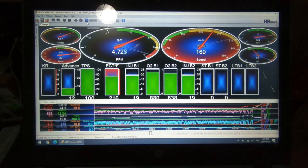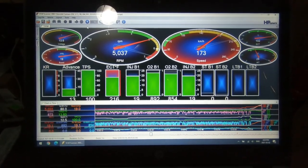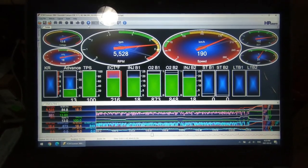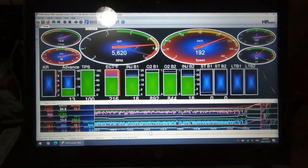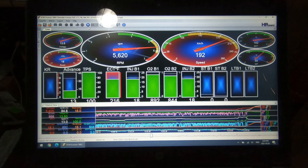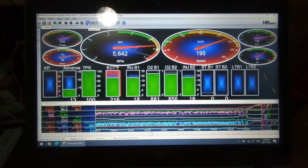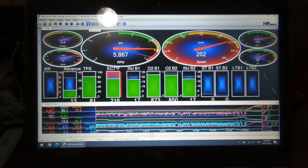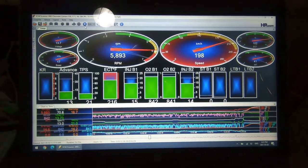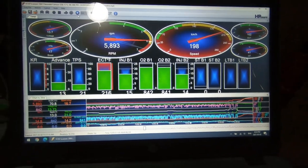So 20, 19, holding. Still going at 19 — at 5600 RPM now, 18 pounds. So it's starting to taper off. It just backed off there and it just started to drop off at 17 at about 6500 RPM.